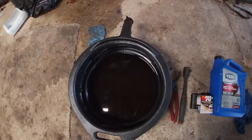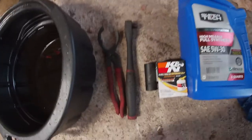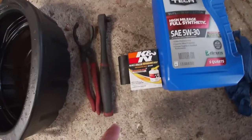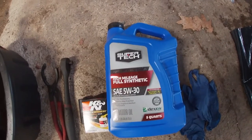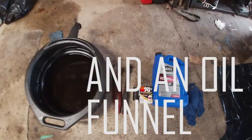Here are the tools you're going to need: an oil drain pan to collect the oil, an oil filter wrench if yours is stuck on, a ratchet, a 22mm socket — I have an aftermarket oil pan so yours might be different. An oil filter — K&N, strictly for performance reasons, actually that's just what Walmart had — some 5W30 if it's cold or 10W30 if it's warm, and a pair of gloves. That's about all you'll need.